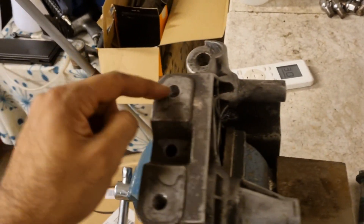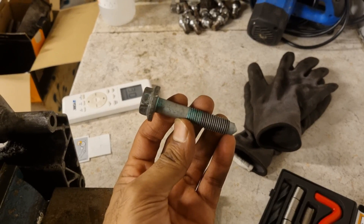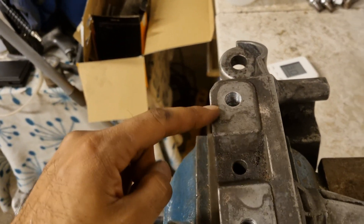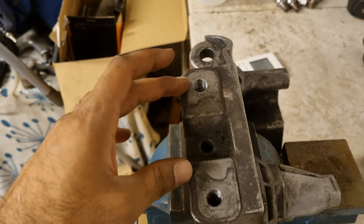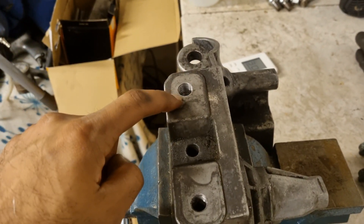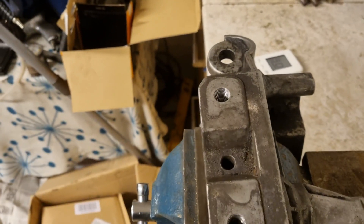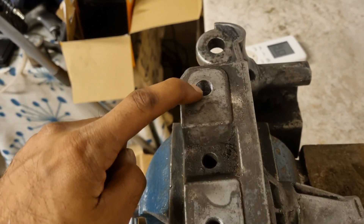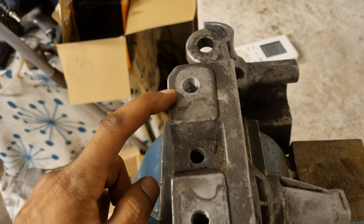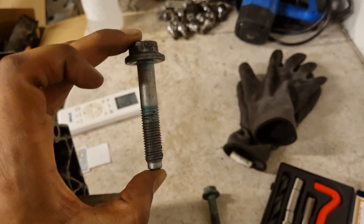Now I need to repair them. There are several ways — two or three options. The bolt is 12x1.5mm. You can't just re-tap 12x1.5 into stripped aluminium. One option is to go bigger: drill to 13mm and re-tap to 14x1.5, but then you need to find new bolts with a 14x1.5 thread and matching diameter, which can be hard or easy depending on availability.